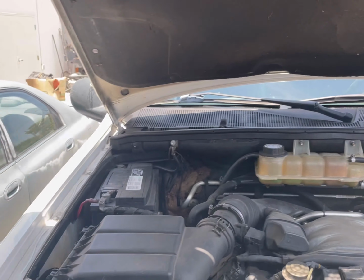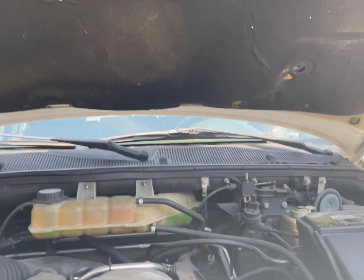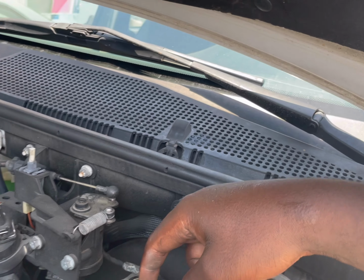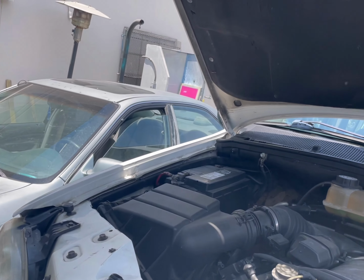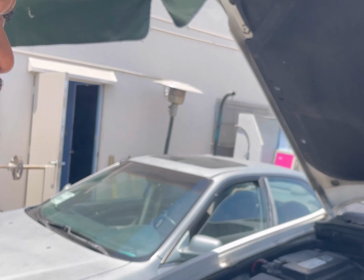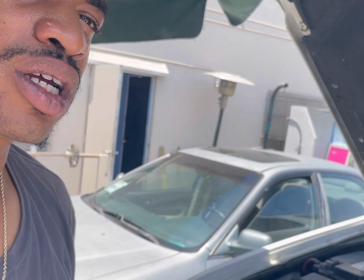To the left and right, you have an assistant pump the brake pedal while you have the brake caliper bleeding screw open, with the tube on it leading into a bottle for the old brake fluid. You have them keep pumping until the fluid coming out of that caliper through the tube is clear. So you're putting new brake fluid in there, and while you're feeding that, you're also putting the line into each brake caliper one at a time. You continue doing that until the fluid coming out at each wheel is as clear as the new fluid that you're putting into the brake master cylinder.